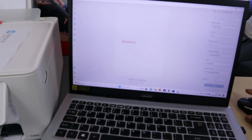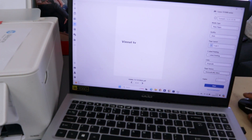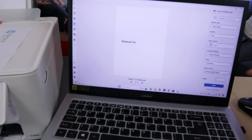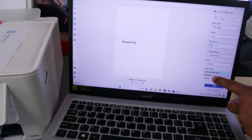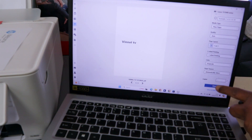For color, we want grayscale — that is black. The document preview changes to black. For paper source, this printer has two paper trays: cassette and rear paper tray. You can select Automatic, or scroll down to select Rear Tray or Cassette. If you leave it on Automatic, the printer will pick whichever is available. Then select how many copies — one copy — and select Print.